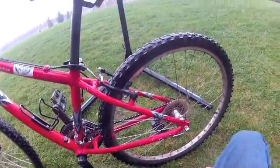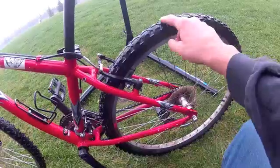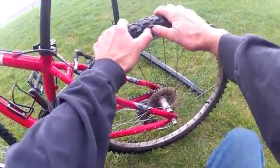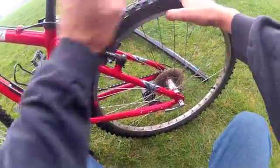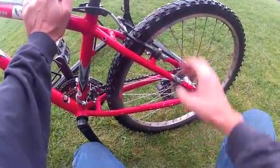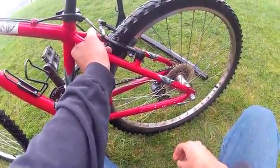For the rear tire, it's a similar check to the front: look for patterns of wear — rounded and dull. This one is starting to get flattened on top, possibly getting time for a new tire. Push with thumbs together — this tire is much softer compared to the front, which is a possible slow leak. Check the skewer by pulling out and shoving back; it should be very tight to close. Grab the rim and the frame and pull back and forth, checking for bearing play.